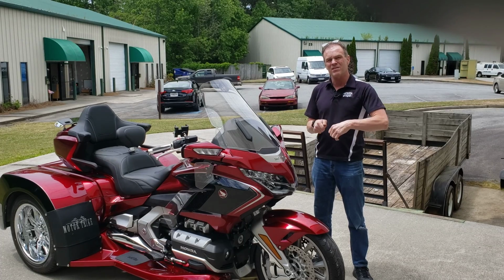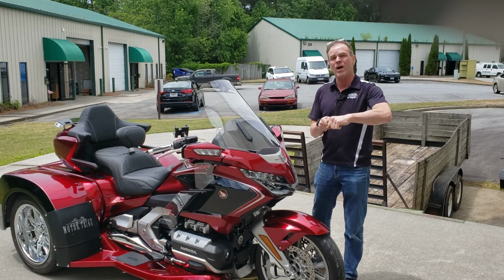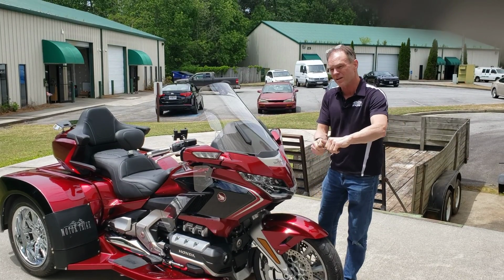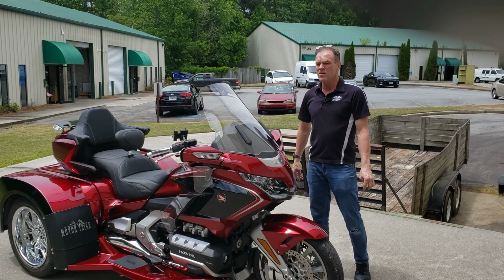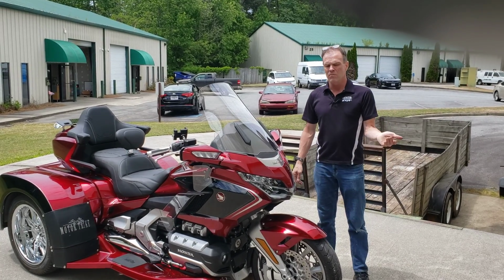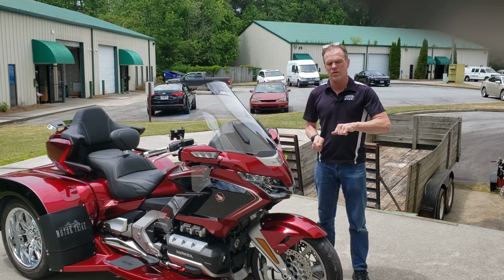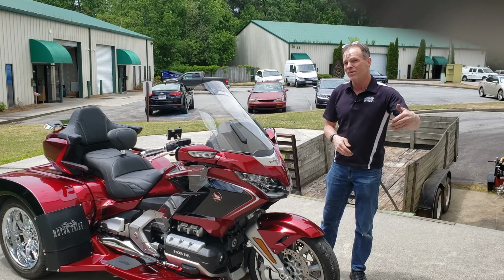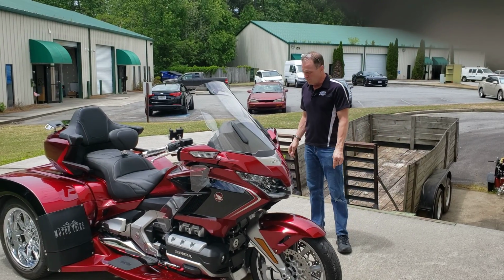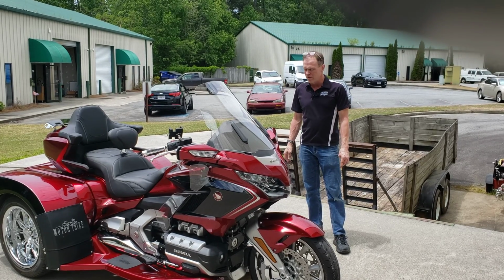Anything that bumps and upsets the tire will make the trike tend to want to ride straight. It won't keep turning until the tire can settle down and then bite again and then continue its turn. So this can be very unsettling when you're going through sweeping curves and bumps, and the trike begins to skip outward into what would effectively be the oncoming lane. So bump compliance and such for trikes is a big deal.